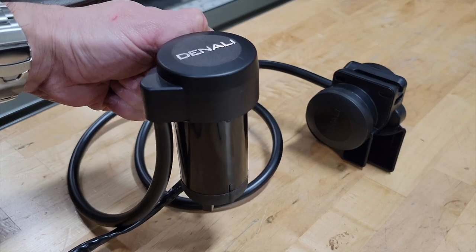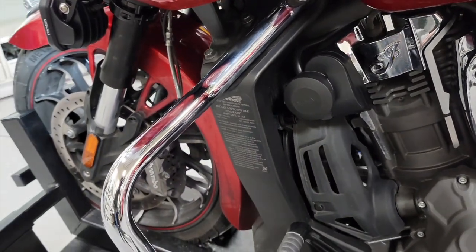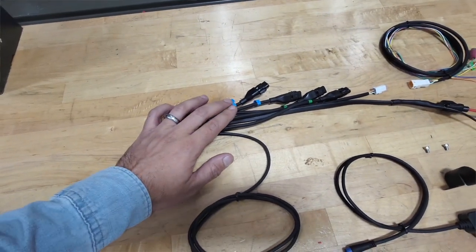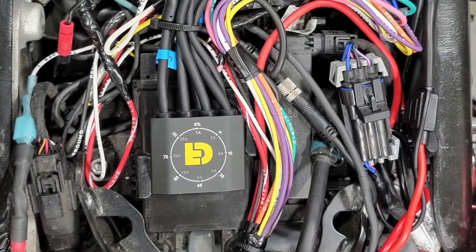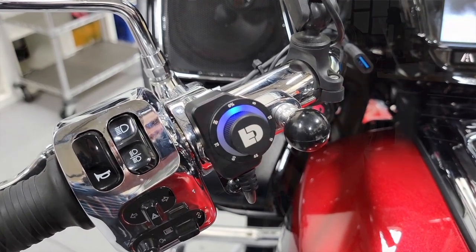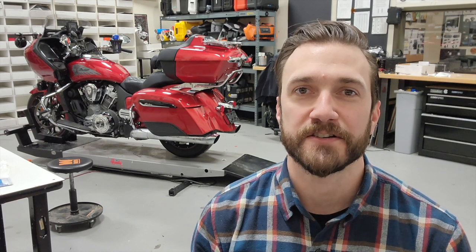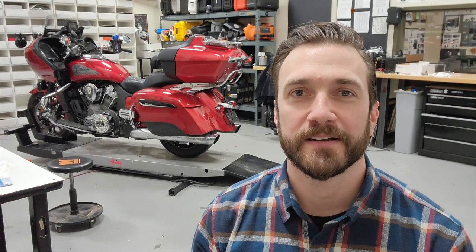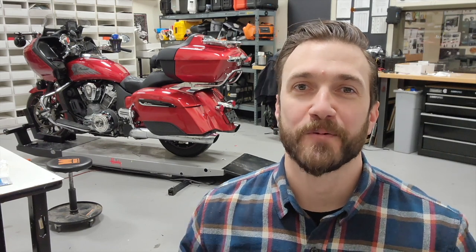For the Split Horn, we mounted the acoustic unit and compressor on simple flat brackets — basic brackets available on our website. The newest Dial Dim controller has a universal harness that connects to the vehicle's battery switched power, high beam, turn signals, and horn to activate all those features. We just identified those circuits on this bike and hooked right up. The takeaway is you can get these products on any vehicle — it's just a matter of understanding what we offer. We'll put links in the description to everything used in this build so you can set up your Challenger, or any other bike, the same way. Thanks for watching!